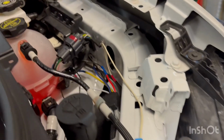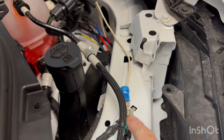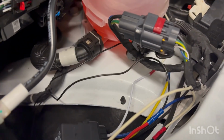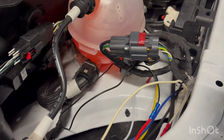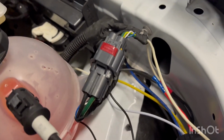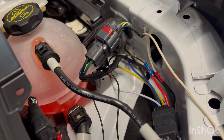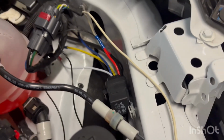All right, here's a look at the relay over here, hooked up final. Here's the ground wire plugged in, going to one lead. There are 4 wires hooked up. Here's the relay right here. One wire is going around to the aux output. I haven't got that hooked up yet. The other 2 are going down the speaker wires that drop down to the speaker. I cut the wire and showed you that on the other video. So this is complete. I just have it mounted loosely for now.